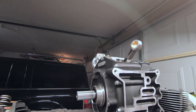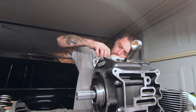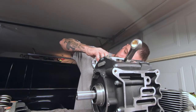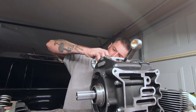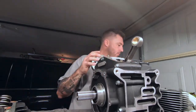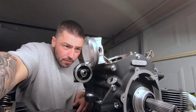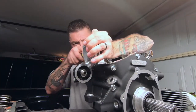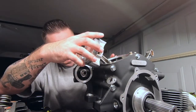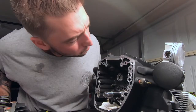What I was talking about with the piston — there was a little bit of wear on the jugs, and there was an indication of where I just rounded off those four corners that looked like it was wearing on the piston. I did show the manufacturer of the piston, and they said that whoever was making the pistons for him at the time may have had a bad machinist. He even looked in the paperwork to see what year it was and who the machinist was working at the time.